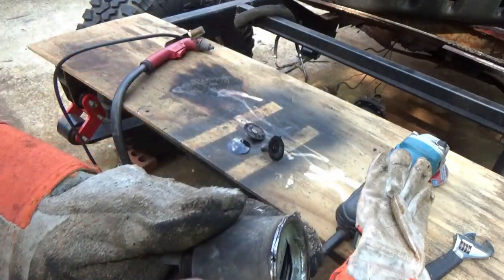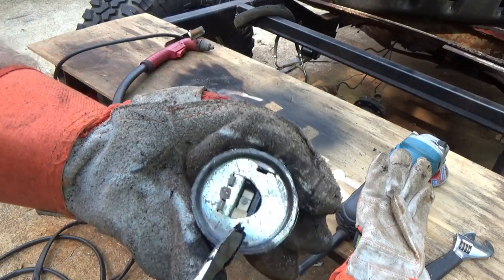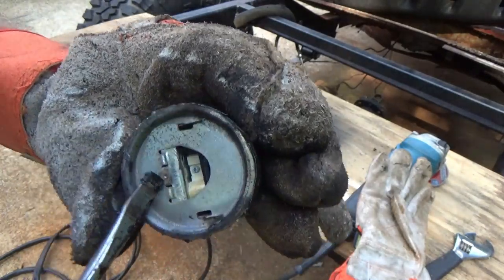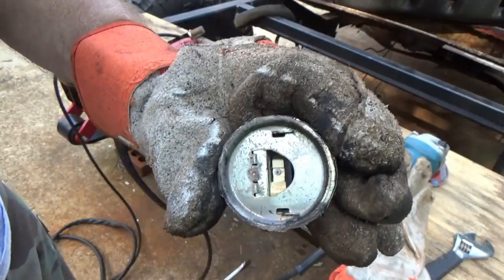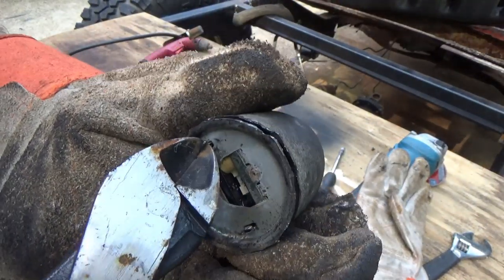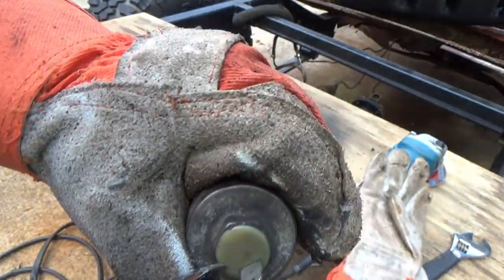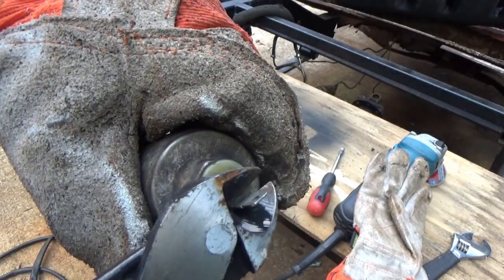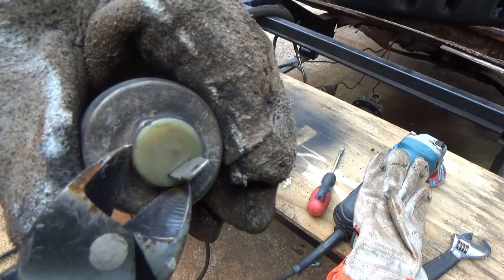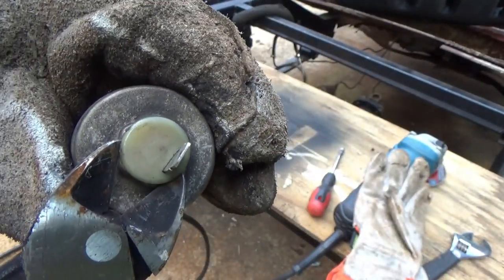Let's see if we can get the other part of it apart now — see if I get lucky enough with the screwdriver without having to do any more grinding or cutting. Okay, it separates. I'm gonna wedge it up a little bit enough to slide — because you've got a lot of little keepers right here for locks, but then we've also got little tabs here that prevent it from sliding forward. The whole thing is breaking loose from the inside now. I'm assuming it's still attached up in here — there's the spade connector that goes to your gauge. This plastic right here probably needs to go, so I'm going to cut that plastic out right there, which should allow me to pull the electronics straight out the bottom.